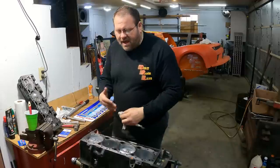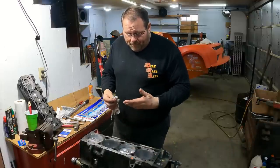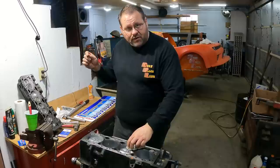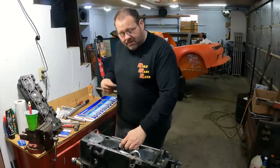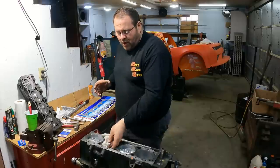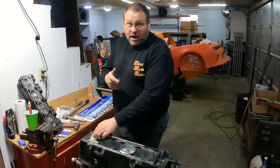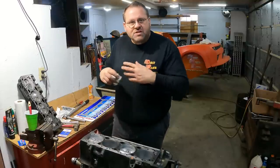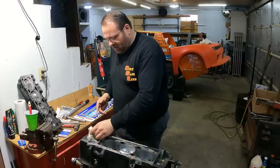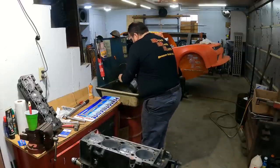You don't need to have a lot of oil sitting up on top of your cylinders to crank it up. Now, saying that, I'm going to set the engine up so that when I go to crank it, it's going to fire right off. I'm going to set the time correctly on it. I'm going to fill the float bowl up on the carburetor so that it's primed. I'm not going to crank and crank and crank. But that oil that's trapped in between those rings, for me, that's plenty. That's fine. There's no point in having all this oil sitting on top of these cylinders, risking a hydraulic lock, which could break a ring or bend something, or just smoking the whole shop out when we crank it up. So I just make sure that I've wiped a little bit of oil sitting around in here, wipe all that off the cylinders. They're fine. I am going to clean my surfaces.